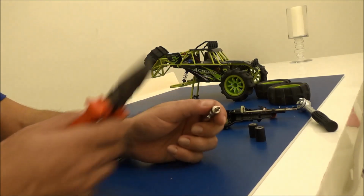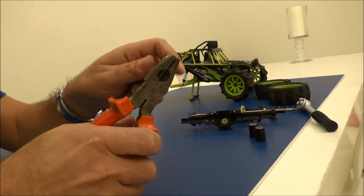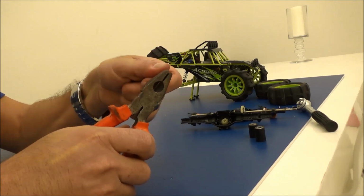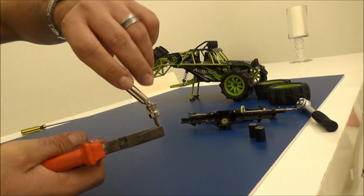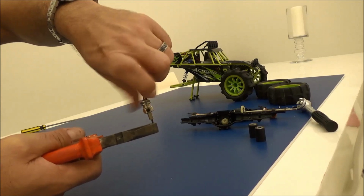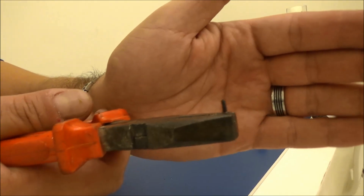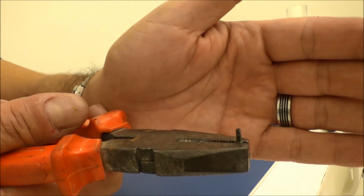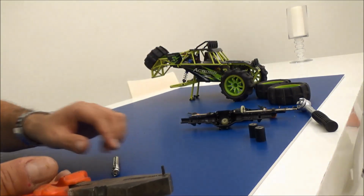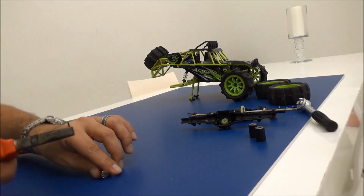So I got myself a good grip pliers. I'll grab the screw and twist the shaft, hoping that this is going to start to come out. Yes. Now, of course, as I expected, there will be Loctite on this kind of screws because it's in a rotating part. The differential is a part that rotates at insane speed. Now I'll find a screw that matches this size, this length, and fix it there.